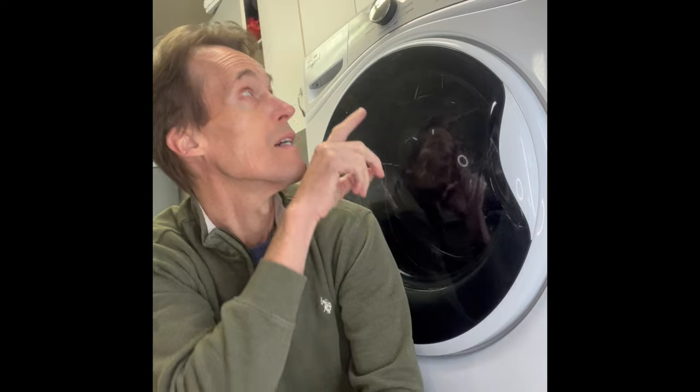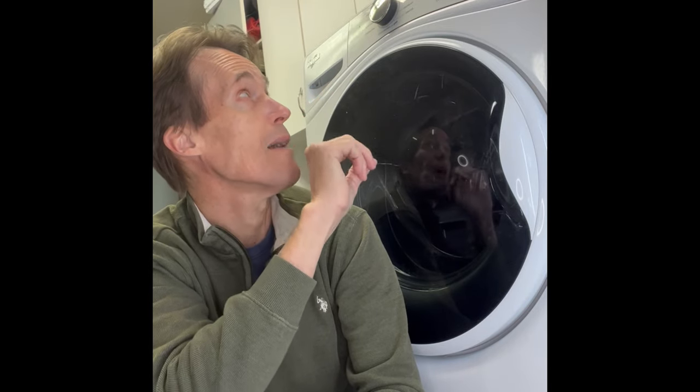The other, more common condition is called a suds condition — that's where too much detergent has been placed into the machine. It creates too many bubbles and suds, and the little drain impeller is spinning really fast but hitting mainly air instead of water. There's not enough resistance, which makes the computer think there's still a lot of water left, so it won't open the door. It'll constantly be in drain mode, won't progress in the cycle, and the door lock light — a red light on this machine — will probably be blinking while you hear the drain constantly going.